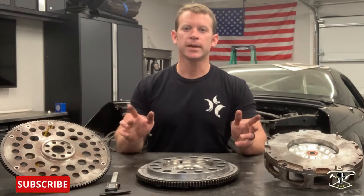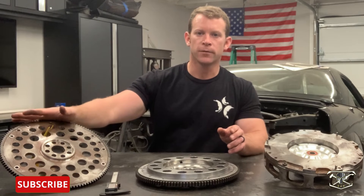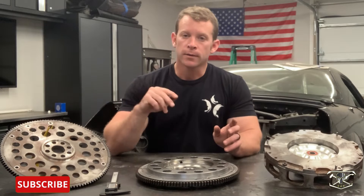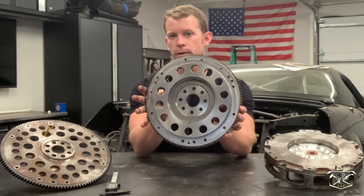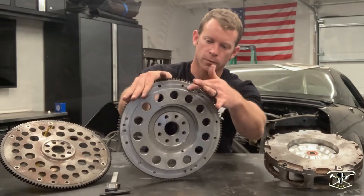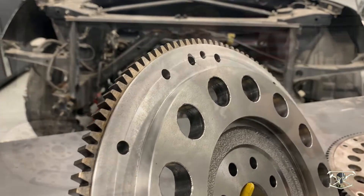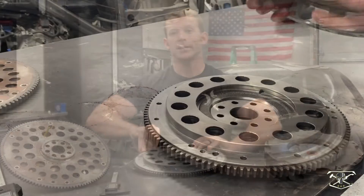Six weeks later and a change of plans — we've come up with a flywheel solution. This was the original flywheel meant for the K-swap motor, and I mentioned we were going to build an entirely new one until I found out that would be over three thousand dollars. So what we wound up with was modifying that truck flywheel I used for fitment earlier. It's been milled on both sides — front and back — and this shoulder right here is what accepts the crown or hat off of the K-swap. Now I want to show you how to assemble these two and get this thing ready for the next stage, which is balancing.